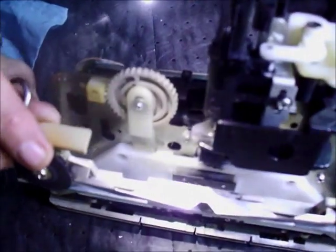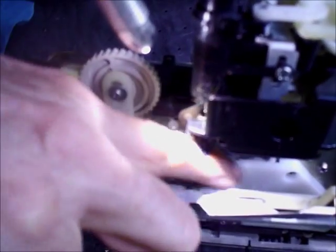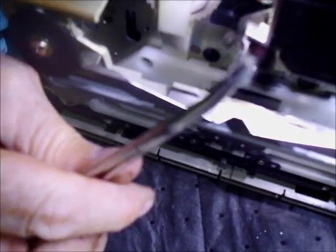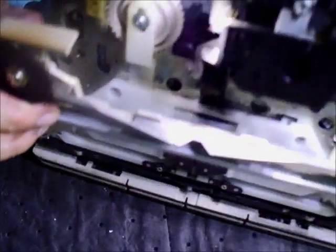Let me tilt it while you look right in there — right in here is a place that catches a lot of that fuzz, and a lot of this is because of that old grease. This area right here where the needle lives — see all the fuzz in there that will have to come out. Now let me rotate it so you can see some of the movements the carriage has to make.